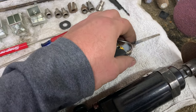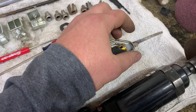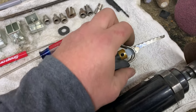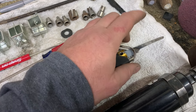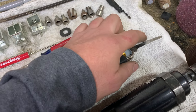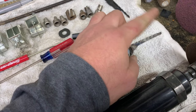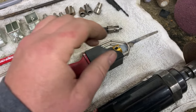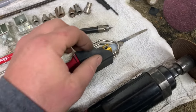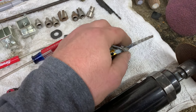The blades, also again, Harbor Freight sells blades for these. I think they're junk. The moment you hit a spot weld or anything with the blades, you can see this one turning kind of blue because it's got hot, but the cheaper the blade, the quicker it's gonna dull. Like this blade has obviously been overheated, but you can still feel the teeth that are plenty sharp. So you get what you pay for with the blades. Again, you can get them on Amazon. The Chicago Pneumatic blades seem to work really well. Morse Cutting Products, they make some really good blades also.